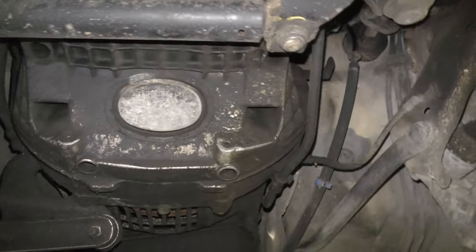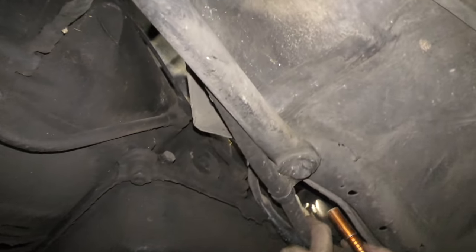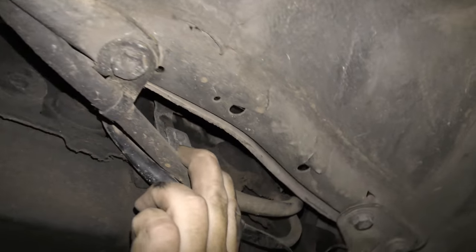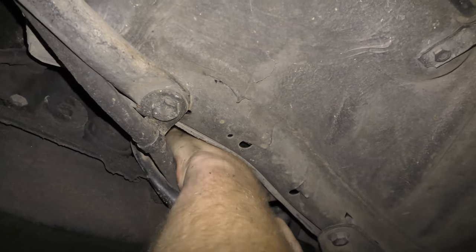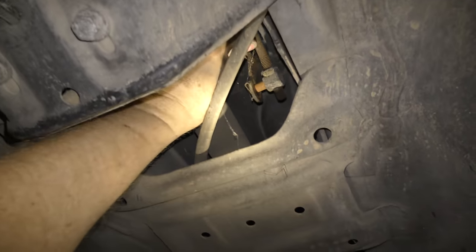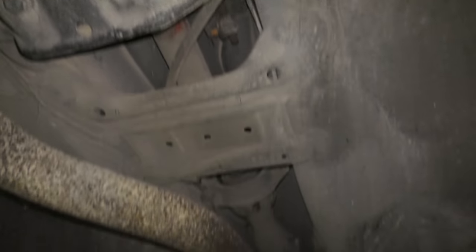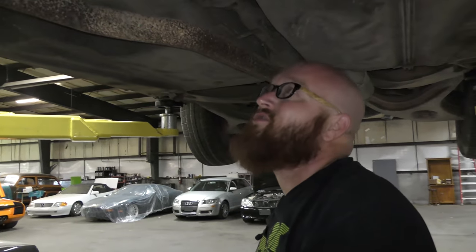The transmissions on these really don't give a lot of trouble. But I can see from experience that the shifter rod bushing is gone — and I can prove that by the noise I'm about to make. That's a very common 123 chassis problem. It needs little bushings that go in there — that's the shifter rod between the shifter and the transmission. Very easy job.